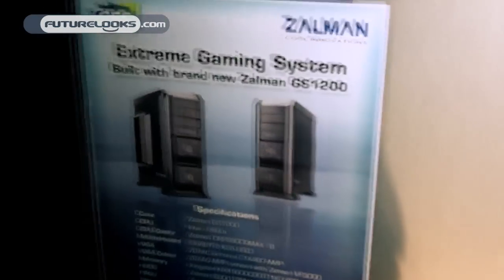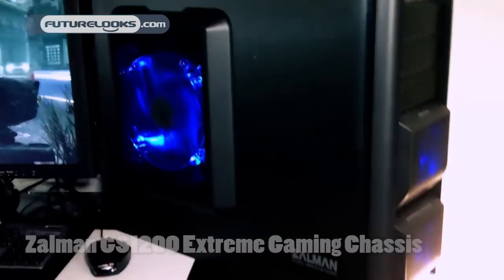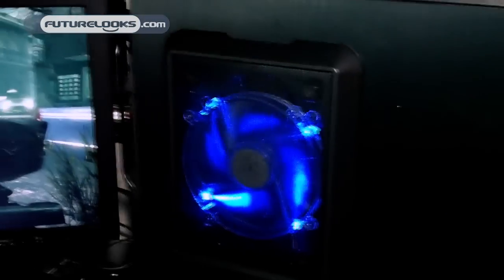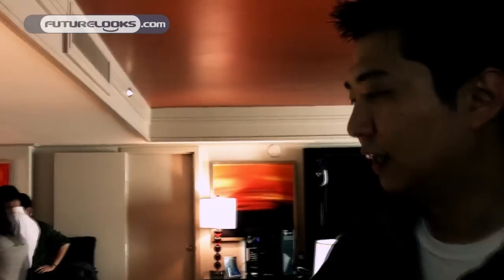This is the brand new GS1200, the successor to our GS1000 Plus system. It has so many features. One great feature is that it has six hot swap drives in the front — very easy to take out. You put your drive in, knock it in, and the backplane PCB will detect it automatically without having to restart your computer. There's also a hot swap bay on top for a 2.5 or 3.5 inch hard drive, so that's a total of seven hot swappable drive bays. We've also dramatically improved airflow, adding a 200 millimeter side fan as well as a top fan. The side fan actually extends out of the side of the case to give clearance for high-end CPU coolers.